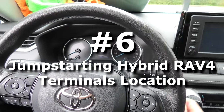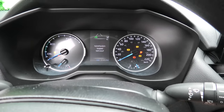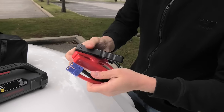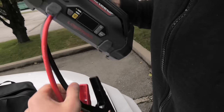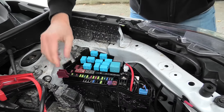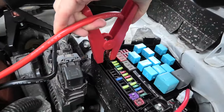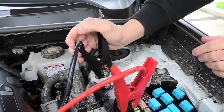While we were working on our RAV4 today, our battery completely died. It says 'Hybrid System Stopped' and nothing happens — it won't turn on, it won't start. Here we have our clamps — this is where it gets connected. Because this is a hybrid, our plus terminal is located in the fuse box right here, so this is where the red wire will go.